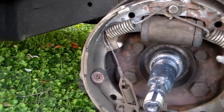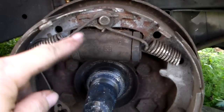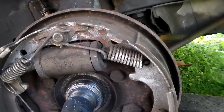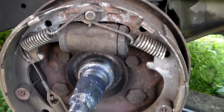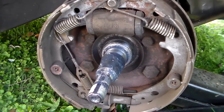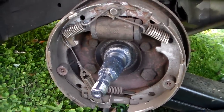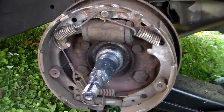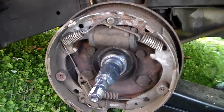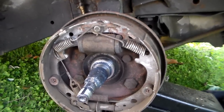As much as I love working on drum brakes — this all has to come apart. It's probably going to need at least that cable fix and almost certainly a new wheel cylinder. Fortunately I've got several new wheel cylinders laying around, so that won't be a problem. I'm guessing those are our culprits, but you want to take everything apart and confirm before buying any parts. Alright, let me get the camera turned off and start disassembling this, and we'll go from there.